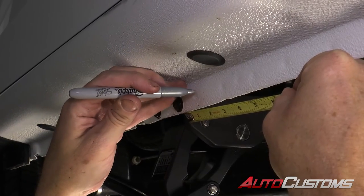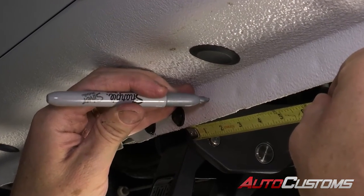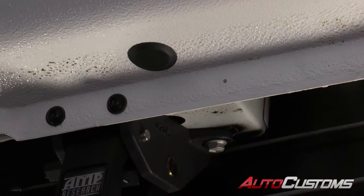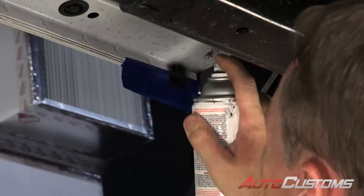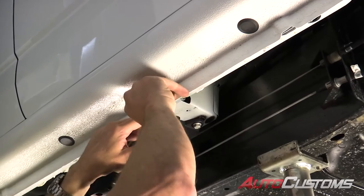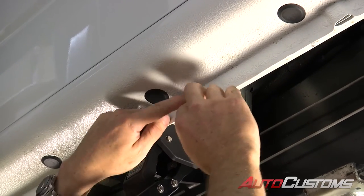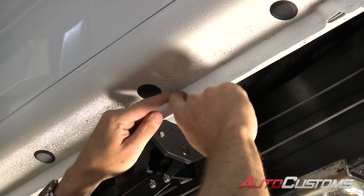Now we're in the front bracket area again. We're going to measure out an inch and a half behind the front bracket going towards the rear of the truck, and directly above that inch-and-a-half mark we're going to mark the pinch weld. We're going to do the same thing to the rear bracket, but we're going to go three inches back past the rear bracket. We're going to drill those holes, stepping them up to a 9/32nds, deburr them, and then hit them with some touch-up paint so they don't rust. Once the paint's all dry, we're going to insert our grommets. We are going through three sheets of steel, so we're going to have to work that grommet into place. It's always best to put a little bit of lubricant on the leading edge of the grommet, something like silicone — it helps it slip into place. Do the same thing in the front bracket.